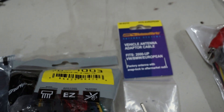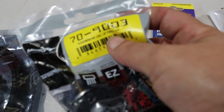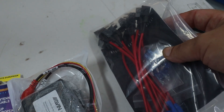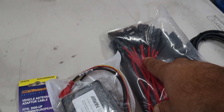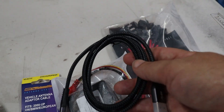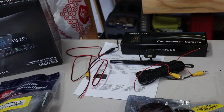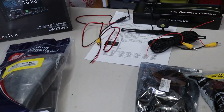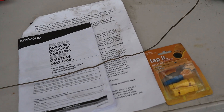The wiring harness is about $10, and the adapter antenna are from Metra — a company that makes a lot of automotive wiring electronics. This is a fuse tap — we're going to tap into our 12-volt power right out of the fuse box. And this is our USB cable which is not only a charge cable but also a data cable. Total cost all in is about $600, and this will be an upgrade since the 2009 Cayman S has Bluetooth but only phone function, not multimedia.